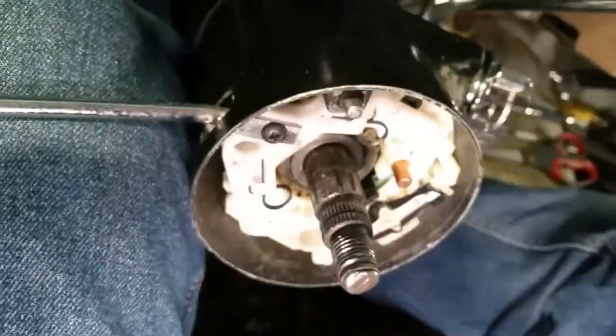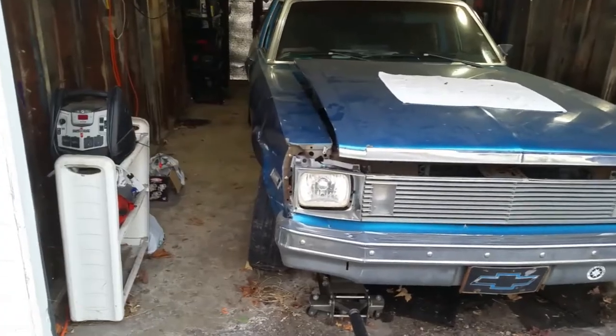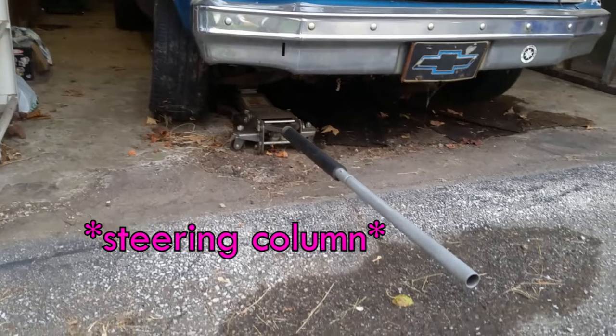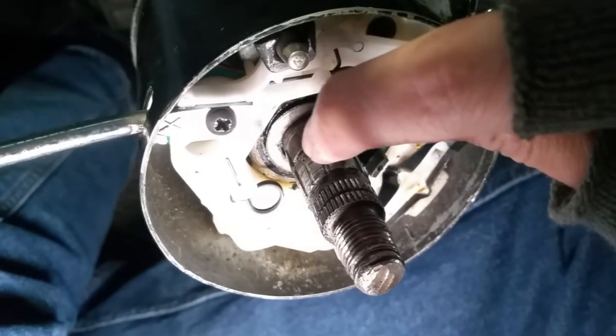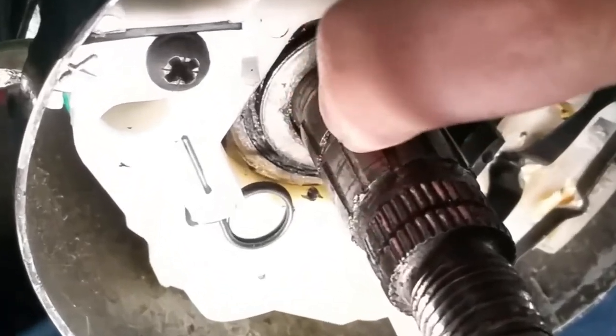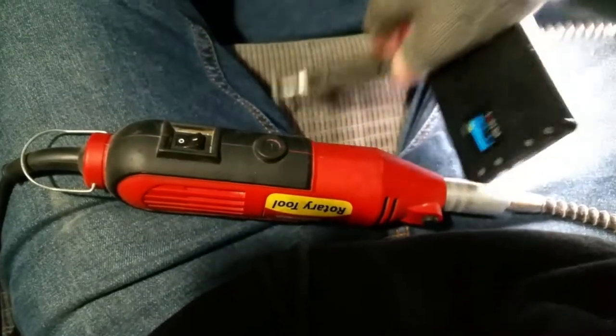In my case I put it on wrong, and I think I cut a new groove into it. But even so, when I put it in the correct orientation with no spring or anything underneath, the farthest down I can get is just a little bit past this. I thought it was because my steering column was jacked up from the car wreck, but I was wrong — it had nothing to do with that. I lifted the car and jerked this thing in and out, and it wouldn't come out anymore. So my next theory is that the extra groove I cut made a bump, and when I'm sliding it down I can't get past that bump. So I've got my Dremel rotary tool and I'm going to try grinding it down.